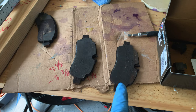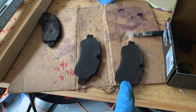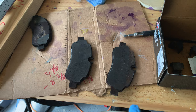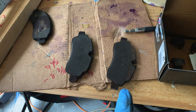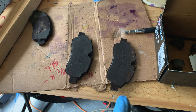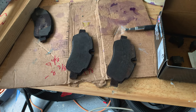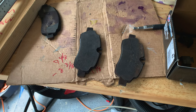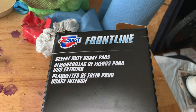I'm not one to change out rotors, especially if it's the first brake change, because most people change out the rotors just because somebody told them it's always good to — which it may be, but I'm not throwing money at a problem that doesn't exist. Also, most of the time the rotors you put back on are not going to be as good as the ones that came on it from factory. People tend to cheap out and buy rotors from an auto parts store, and you're going to get a cheaper version than what was on it.